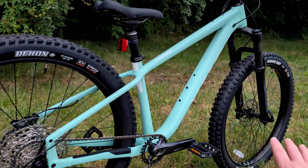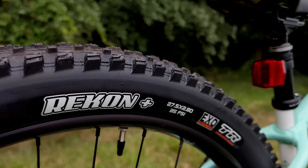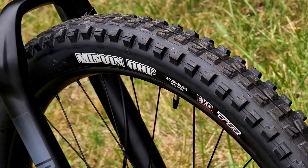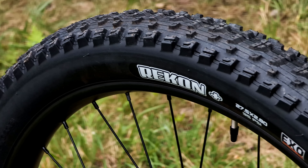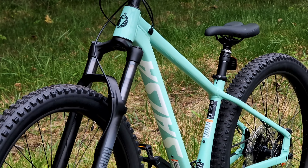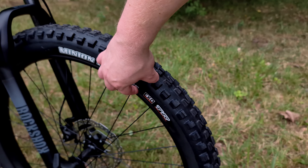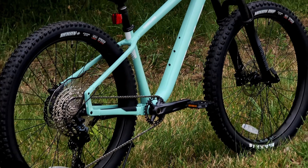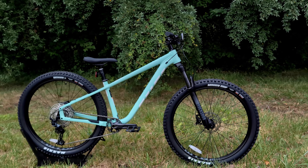The other place where this really comes into play is tire and wheel size. You'll see here we've got some 27.5 by 2.8 inch Recons out back and Minion DHF tires up front. The 27.5 plus tire size — anything from a 2.6 to a 3.2 inch wide tire — has not had a strong hold in the hardtail market for a few years. But the benefit of that 2.8 inch tire is a wider balance point, a much taller sidewall compared to traditional 27.5 in a 2.3, giving you more traction and a wider envelope of capability, making up for a little bit of rider skill.